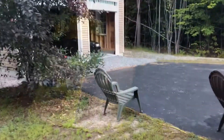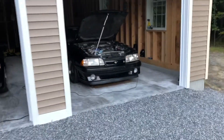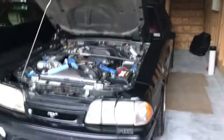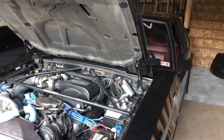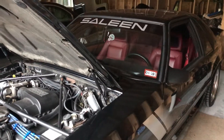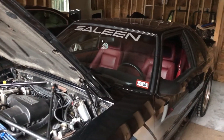It's much later now — you can probably tell by the light. I did go for a long drive, almost 50 miles. I actually ended up hunting for a 30mm socket for doing a fluid change in the differential of the Jeep YJ — another project. So I did clear all the codes, went for a drive, rechecked everything key-on, key-off, key-on engine running, and all the cleared codes are gone. Interestingly, it did pop up a new code — a 67 in key-on engine-off, which is the clutch cancel switch circuit failure. But the thing only starts with the clutch pushed in, so it's still working. Same thing with the fuel pump code — the car runs and drives. It's not an exact science, I guess. It throws a new code out of nowhere when you get rid of the old ones.